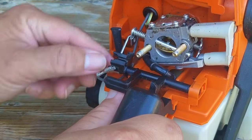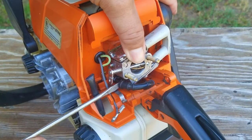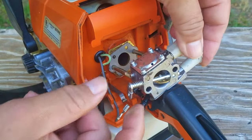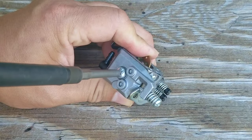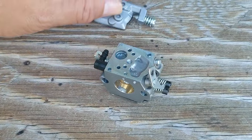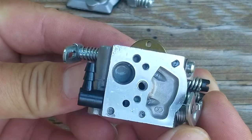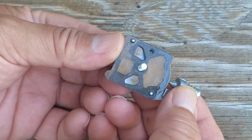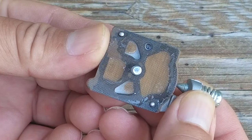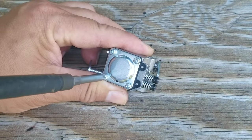Be extremely careful when dealing with this style of choke system — I'm not very fond of it, and chances are if I have a hard time with it you probably will too. Once the linkage for the choke is finally out of the way, slide the carb off the studs and start the inspection. After taking off the single bolt and removing the cover, we can see the round inlet screen in the body of the carb. The first thing to make sure is that it's clear of any debris — ours is, but if yours is covered it means your fuel filter has come off the fuel line inside the tank. Looking at the pumping diaphragm, I plan on reusing it, but we just need to make sure these two flaps are not bent out of shape — luckily this one is just fine, but if yours are bent you might want to consider replacing the entire carb.